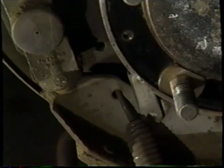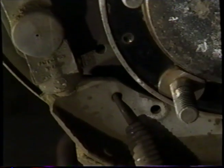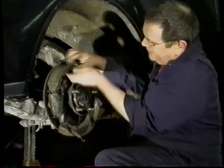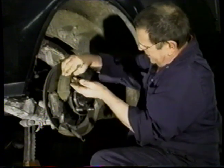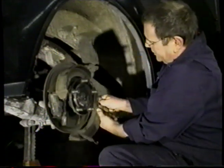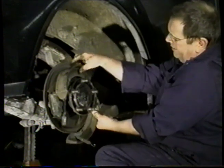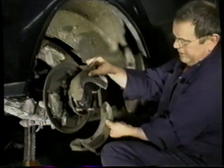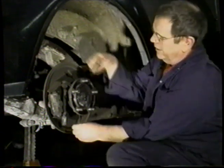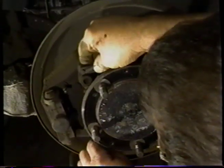Take that pin out. Taking the linkage off the brake shoe. Now we're going to pull down, pull up. Then we're going to pull the shoe off the back, off there, we'll work it around, and that removes the shoe. So we're going to pull this piece of linkage off just to get it out of the way,